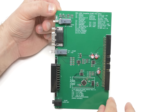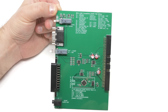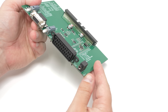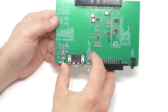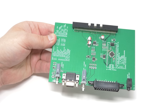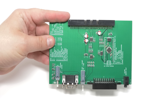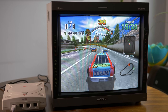But Martin wasn't done. He kept working on the project and came up with the 129X Dual — an input card compatible with all the same monitors, but with a SCART and a VGA input. You can toggle these inputs with a push-button switch located between them, and the SCART input also breaks out the audio to a 3.5mm jack, so you can route it back to the monitor or to external speakers. The VGA input also has a switchable sync combiner, meaning you can directly connect RGB-S with a VGA cable from devices like the MiSTer or Ashenworks' JAMA Mini. If you toggle the sync combiner button, you can connect RGB-HV — so regular VGA. This card essentially turns an L5 series PVM into a really, really nice VGA monitor.